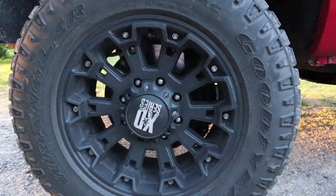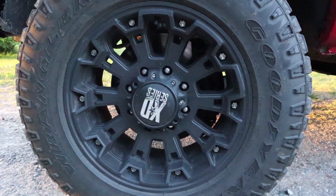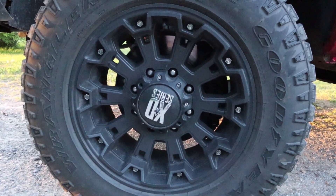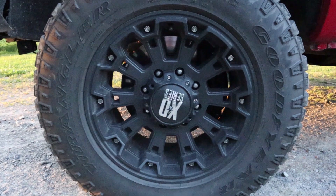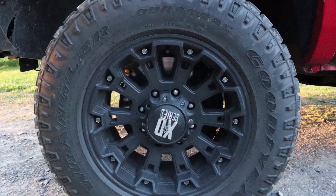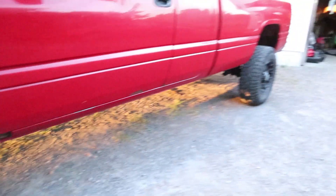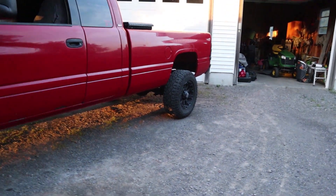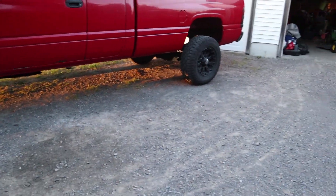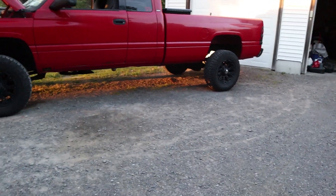I always like to check the brakes — make sure the pads still have good life left in them depending on the length of the trip. If your pads are getting a little low, it might be worth changing them and possibly the rotors too, just do a whole brake job before you take off. We just did the third-gen brake upgrade on my 24-valve a couple months back and we have all new drums and shoes in the rear, so my brakes are good — though they have developed a little squeak and I don't know why since everything is brand new.